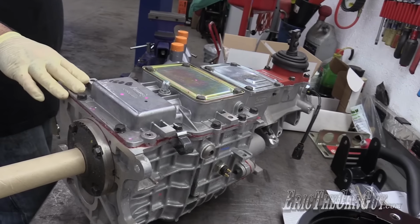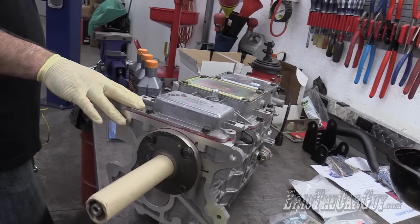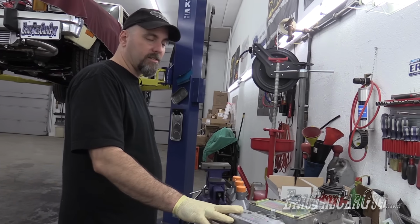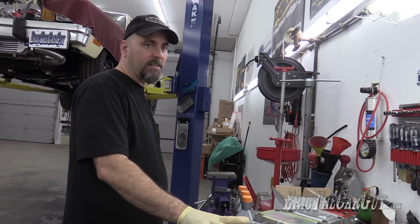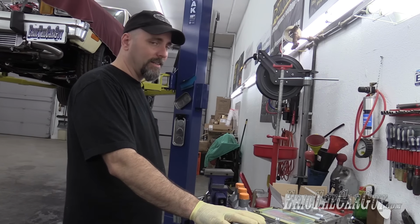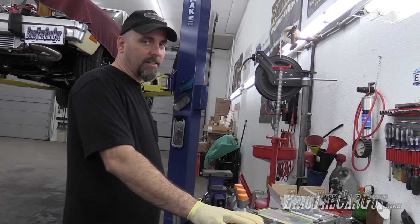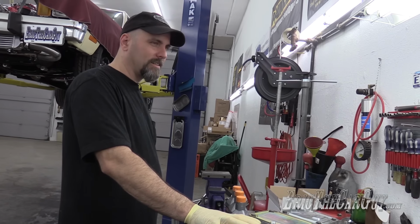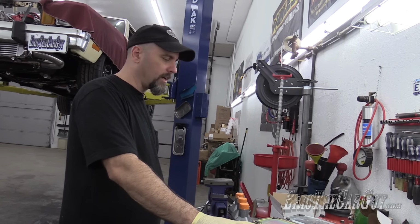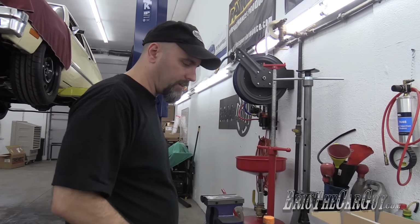TKO600. Now this is rated to handle up to 600 pound-feet of torque. I'm at 622, so I'm a shade over. I am a little concerned, but I'm a lot less concerned with this than I was with the T5, because when I talked to Paul Cangialosi, I asked him about it. After I got the dyno numbers, I said, do you think the T5 can handle that? And he says, no, it won't. I think he said the T5 was good for up to like 350 horsepower, somewhere in that neighborhood. Anyway, I'll put the specifics in the description since I can't think of that at the moment.